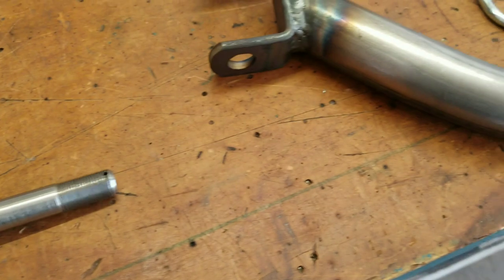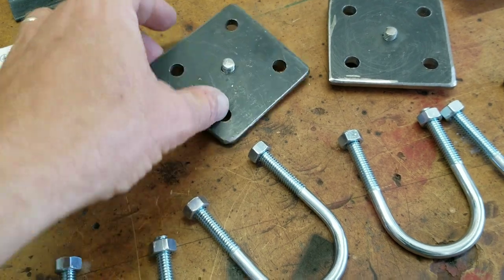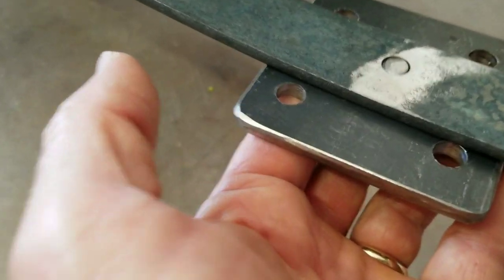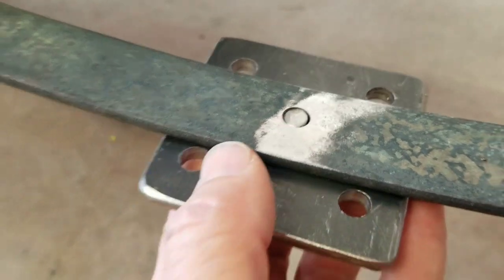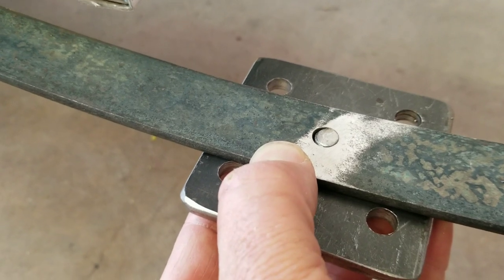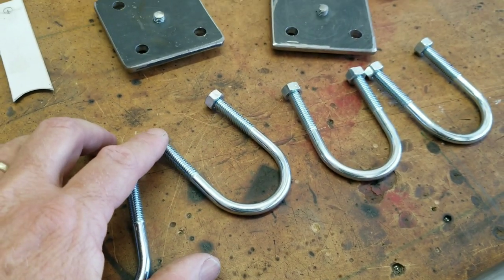When I made these brackets, they're quarter-inch steel. I drilled them for the U-bolts to fit, and made them a little closer together so they're closer to the spring when installed — that helps keep everything captured and in one spot so it doesn't move around. This will help keep your axle from sliding back and forth, and during assembly it's a lot easier to get it mounted. All you have to worry about is the rotation of the axle to get it straight up and down when you tighten it. I'm using standard nuts for now but have nylock for the final installation.